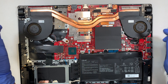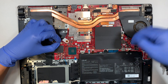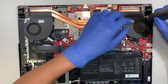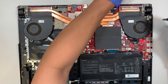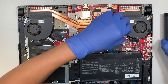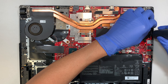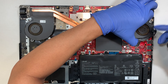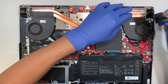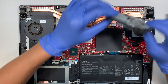The first thing I need to do is slide down the CPU fan connector — there's no clipper or anything. For this one, you slide it down toward your body, and for this connector here, slide it to your left. Let's go ahead and remove the screws. You also need to peel off this little plastic piece, and the entire fan will just come out without any problem.